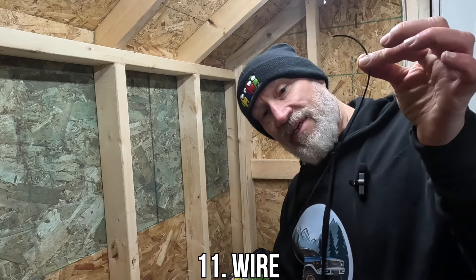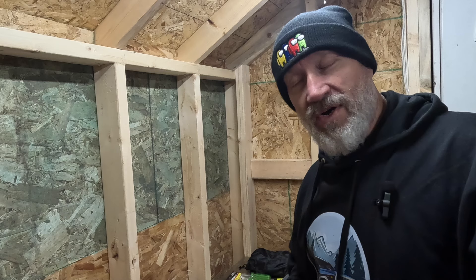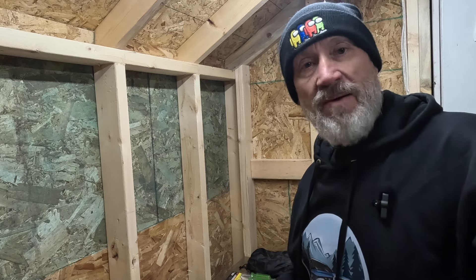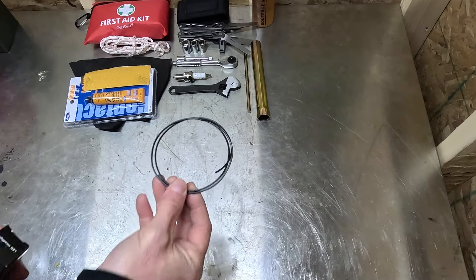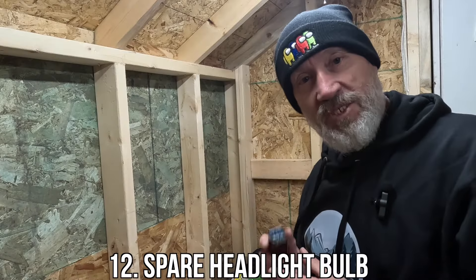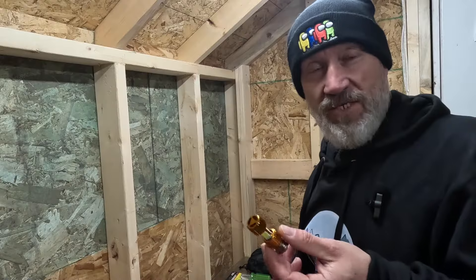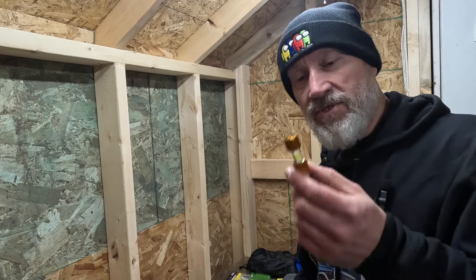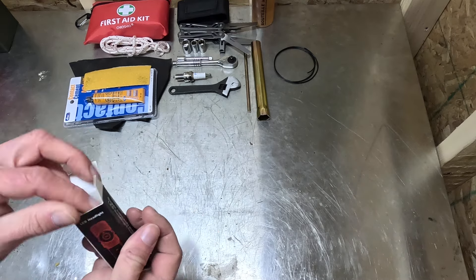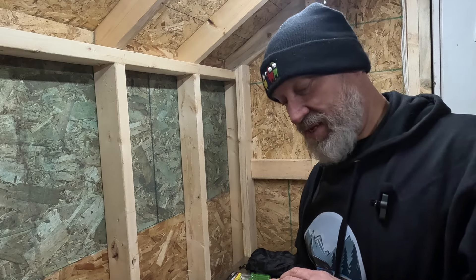A little bit of wire — literally two feet of wire. There's not a lot of wiring that can go wrong on these bikes, but if you have a spill and break your kill switch for example, maybe you just need to hotwire the bike. Just have a tiny bit on hand. Speaking of wires and electricity, a spare light bulb. This is a P15D LED bulb — it does work with our bikes. Keep it in the box in your kit, because if your bulb goes out when it's dark, you don't want to be relying on your cell phone flashlight to see down the trail.